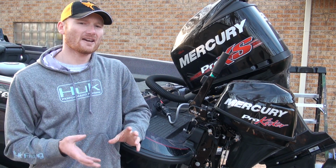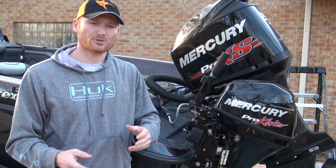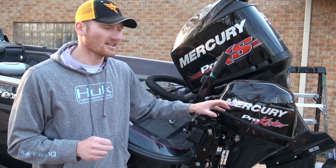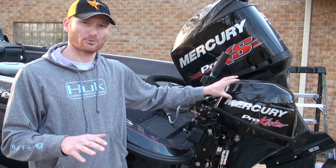But most of these manufacturers, a big tip here is they're going to come with no oil in them. Okay, 4 strokes, lean over, it's going to run in the pan, it's going to be a bad deal, it's going to be a hot mess. But read your manual on the kicker. Okay, I don't remember off the top of my head exactly, but I want to say it's about 27 ounces that my Mercury Pro kicker takes.